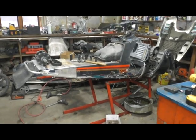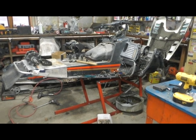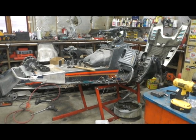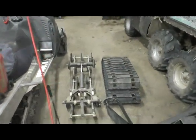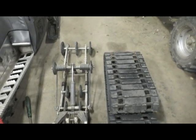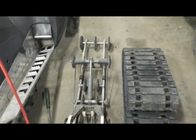That's the teardown for today. I gotta get some parts on order, some bearings, some gears, so we can start putting the other parts back in and get the 156 skid and track in it with a 2-inch paddle, instead of this 136 with 3/4 rib and this old skid that rides poorly.